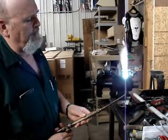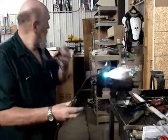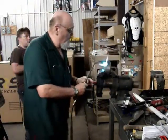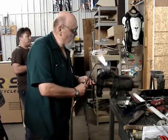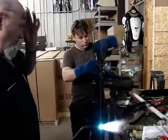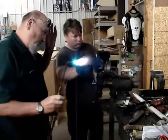Jesse's helping me. I show here that we used a two-man program here. One guy heats up the bolt individually, one at a time, just a few seconds, and that gets your green Loctite warmed up enough that it will release, and Jesse gets right in there with an Allen. He's wearing welder's leather gloves so he doesn't burn himself accidentally. Then I go for the next one.